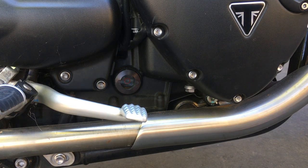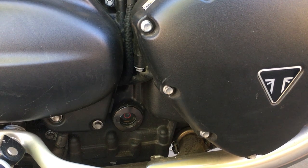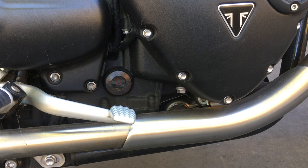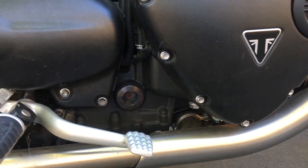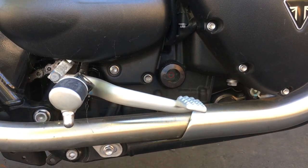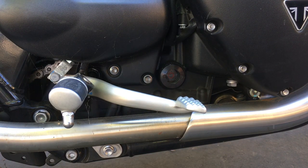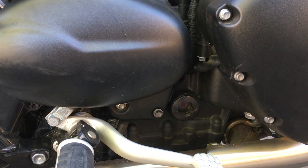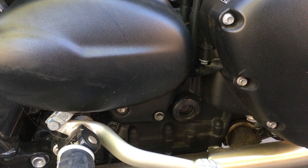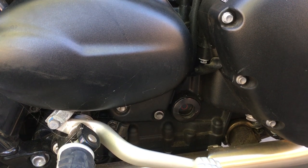Seconds or so. Let's see what the oil level is at. Oh, it dropped. Oops, I was forgetting about neutral. Excuse me, not put it in neutral, put it into gear so it doesn't roll back. Okay. Let's see how much it dropped. Oh, it dropped quite a bit. Earlier I mentioned it was about 2 millimeters above the red circle. Now it's about 2 millimeters below the red circle.